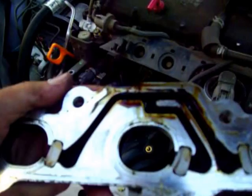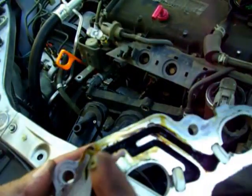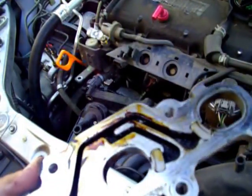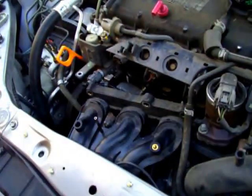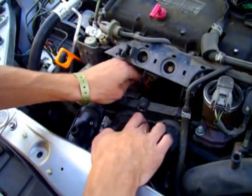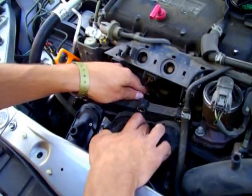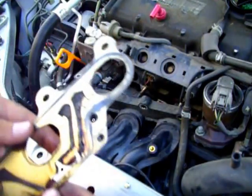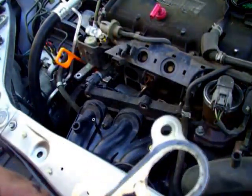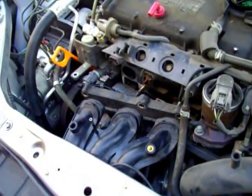So you can see here, that is the EGR plate. Not actually quite as bad as I expected, but it's very oily, which doesn't make me too terribly happy. We'll set that aside for now. We're also going to want to take off the gasket and put a new one on there. At minimum, you're going to want to clean it — this one's pretty dirty. So, that's that.